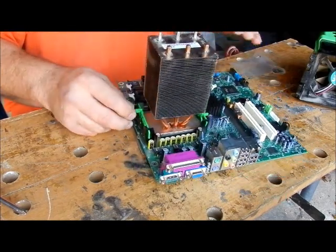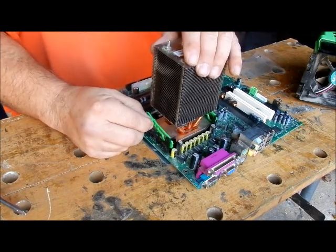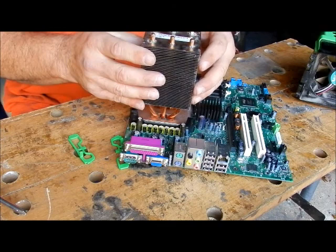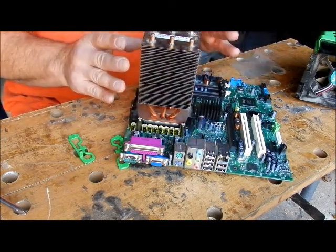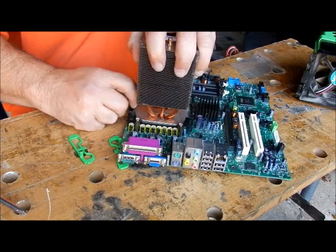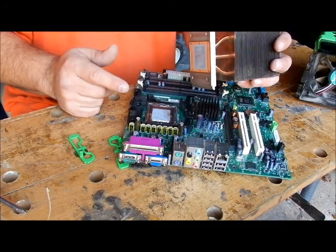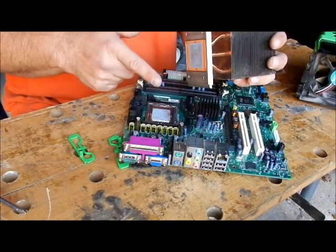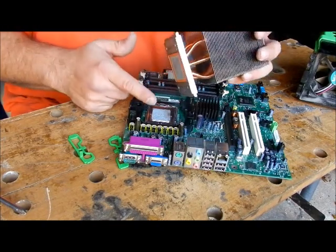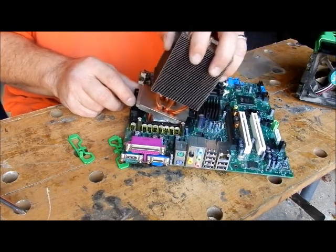Now I'm going to go through the uninstall. On the uninstall, you're going to press on this side — it's a little difficult when the power supply is over here, so I take the power supply out to get down here. Push this in and lift this up, same thing on the other side — push in, lift up. Because there are no mechanical items here like a fan, you should never have to take this out, but dust does build up on it. You're going to pull this back until it frees up, then slide it out. When you do this, you need to put the thermal paste on there — clean it off and put new thermal paste on before you put it back on. Never use dried-up thermal liquid on both sides, because the heat transfer will not be sufficient, and never put metal to metal because you'll get a burnout.